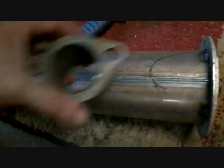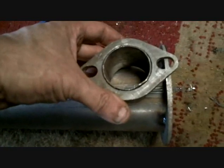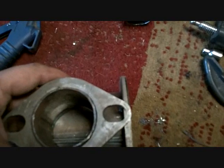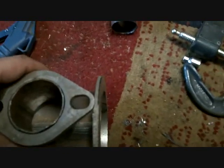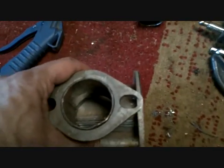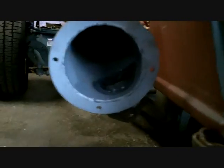I held it against the body and spaced it away — it was two inches. What I want is the edge of this flush with the edge of the face of the other flange, so that's gonna be about right there when I'm done. I spaced it where I wanted, set it at a 30-degree angle, and it kind of points down and under the car. See it under there — it can hook under the car, nothing in the way.